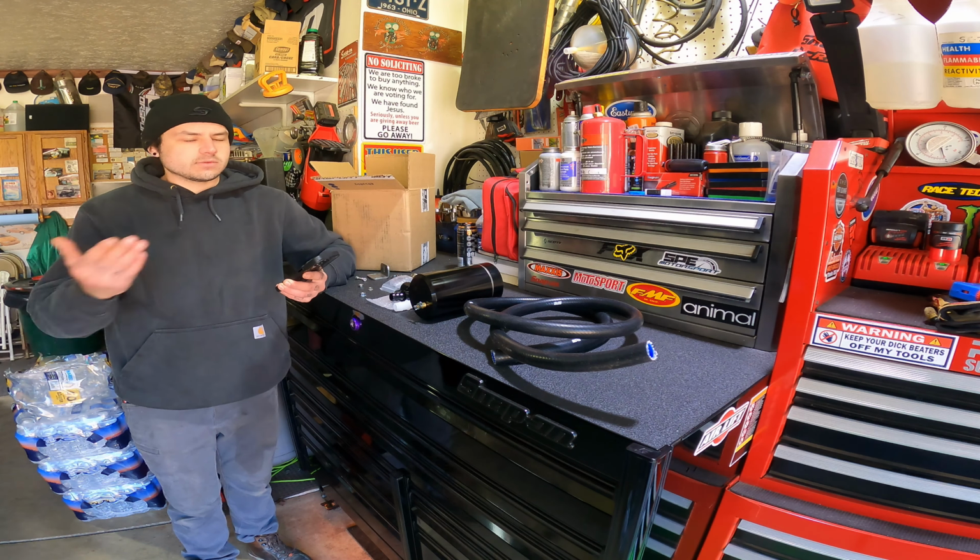So the core of our design is a woven stainless steel media housed in a baffle assembly that effectively filters oil vapor. This system ensures that vapors hitting the deflector plate are condensed and drained back, keeping the oil from coating the bottom of your truck's cab.